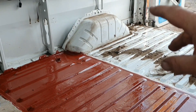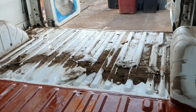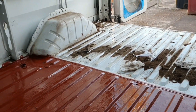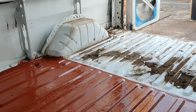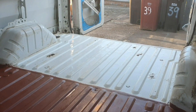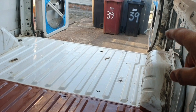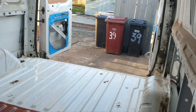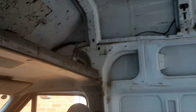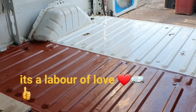I'm also going to paint the wheel arches red oxide, because where the wheel arch covers - the square plywood ones - they've screwed them into the wheel arch so that'll need protecting as well. Might as well just do the lot, I've got enough paint. That's the last bit of floor de-screwed and cleaned, just need to paint that now. When that's dry I'll do the wheel arches, then clean all the rest of the paintwork inside and start messing with that shelf - thinners on it, then the wiring, remove the lights. Oh it's never ending but I love it.